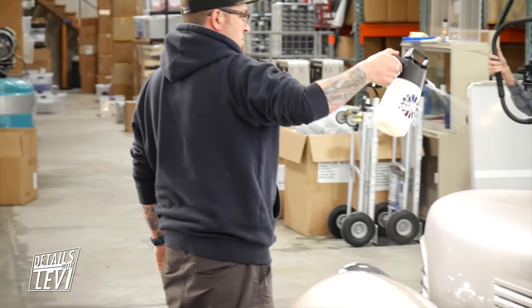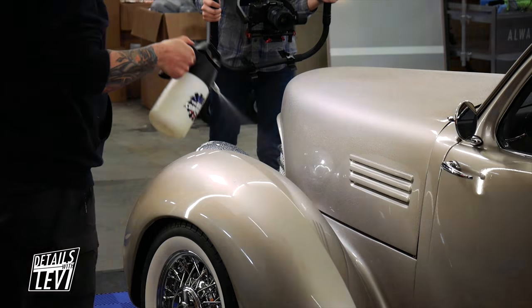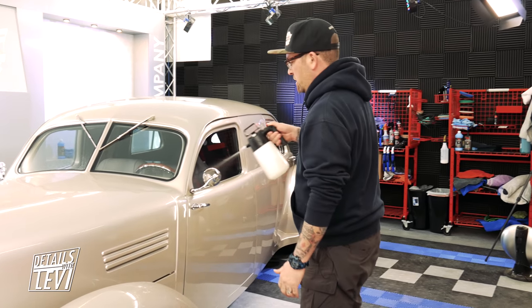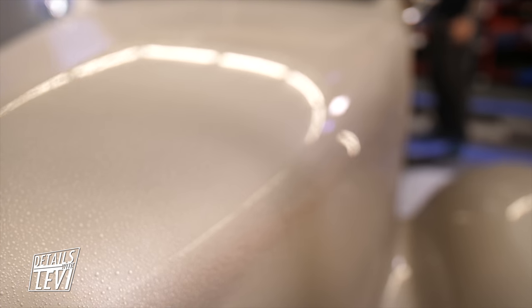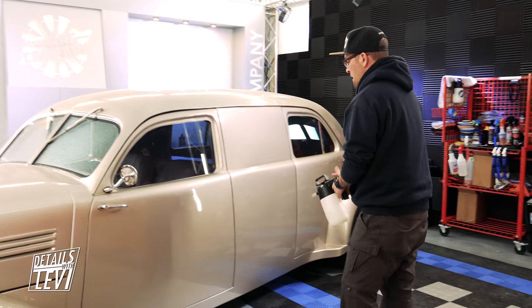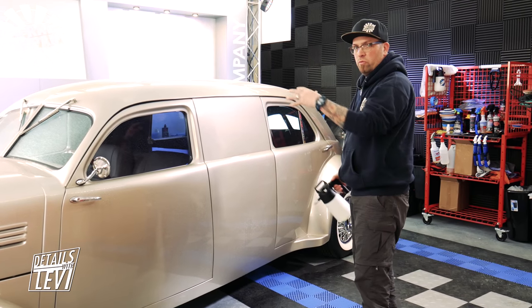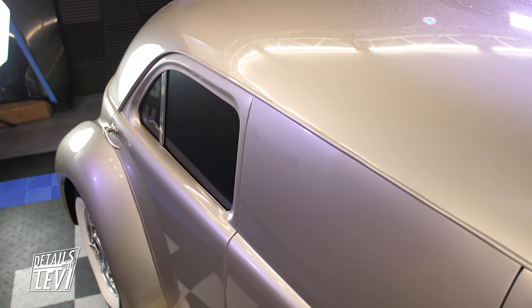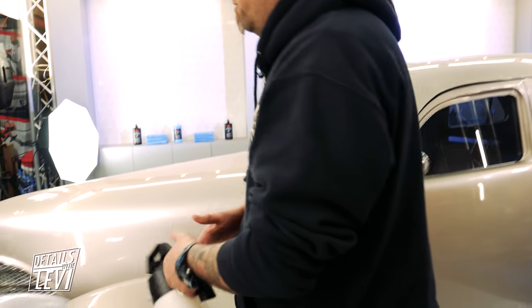With the IK pressure sprayer — give it a pump, that's how you know it's pressurized — wash top to bottom. I'm going to start by spraying the car down nice and even, getting all that dirt encapsulated and emulsified. If you're working in direct sunlight, work panel at a time: a fender, a hood, the roof, driver side, passenger side. I like giving the roof a little overlap so when I come back to do the top half I've already got liquid on there — saves a little extra time.